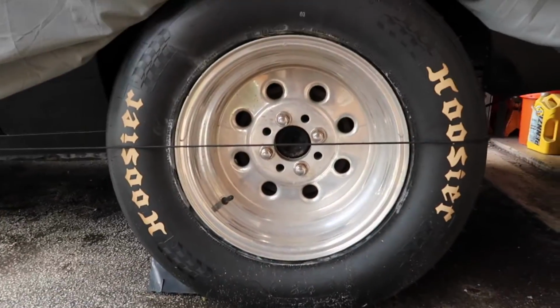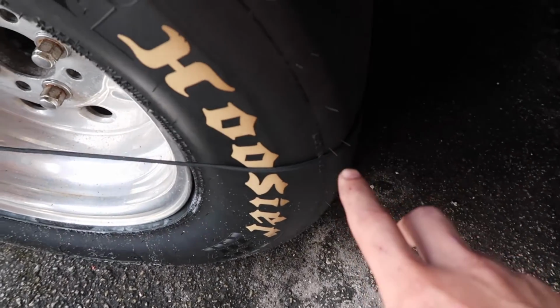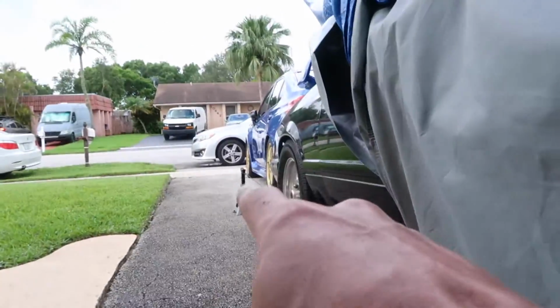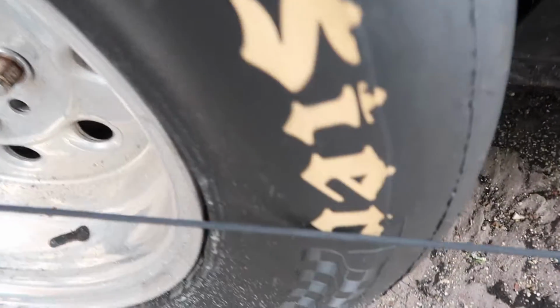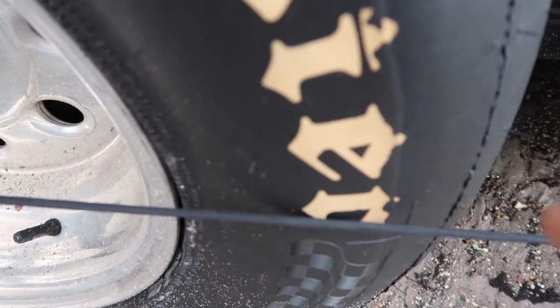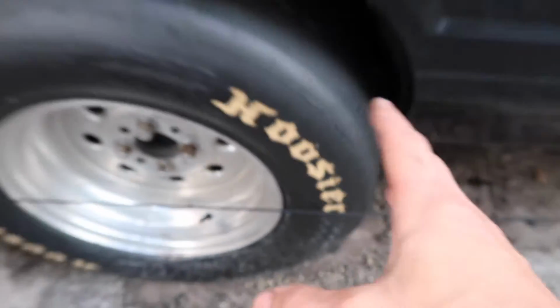like so. And so it's gonna be fully resting on the rear side of the rear tire, and then you're gonna wanna adjust the jack stand in the front so that the string that's touching the sidewall on the front of the rear tire is barely touching. As you guys can see, let me see if I can get it focused. You guys see how it's right there. Same deal on this side. The string is, focus, just barely touching the sidewall of the front of the rear tire.